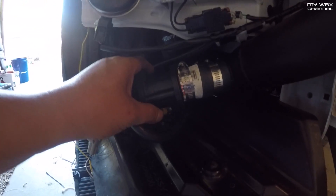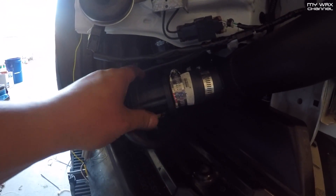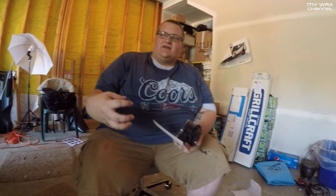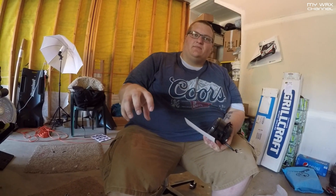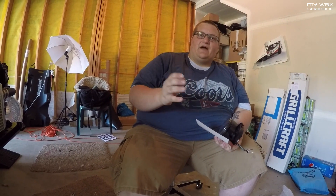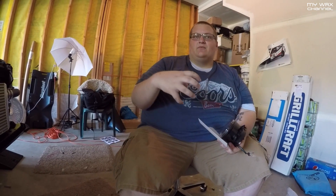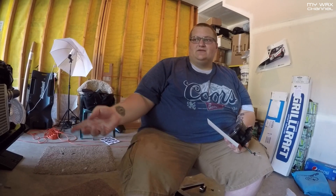The problem we were having — looking at the stock bulbs with the fans and all that stuff sticking out the back — it would hit the bypass valve. They would fit in there, but snug. Every time I got on the gas, the piping would move and I could hear it rubbing on the back of the fog light bulb. When we went and did the autocross, I came home and the fog light bulb was ripped out of the back of the housing and just laying inside. That's why we upgraded to these.